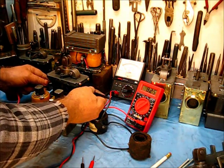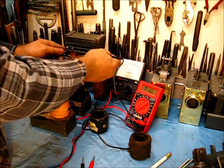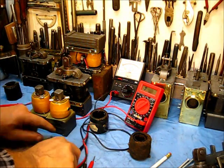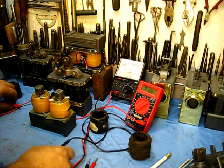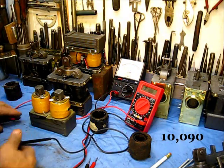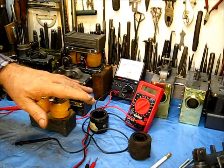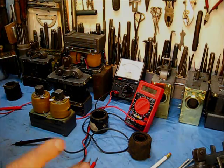You have to get the probe onto the lead out. I've got eight point two four total for two coils on that one. Up here with the new coils purchased recently, connecting the two together with this spring from the workbench, I've got ten point nine for these two combined. So you can check them in the magneto to make sure the secondary is good. I'm using a range of about seven thousand to eleven thousand ohms — it's a pretty broad range but all of that will work.